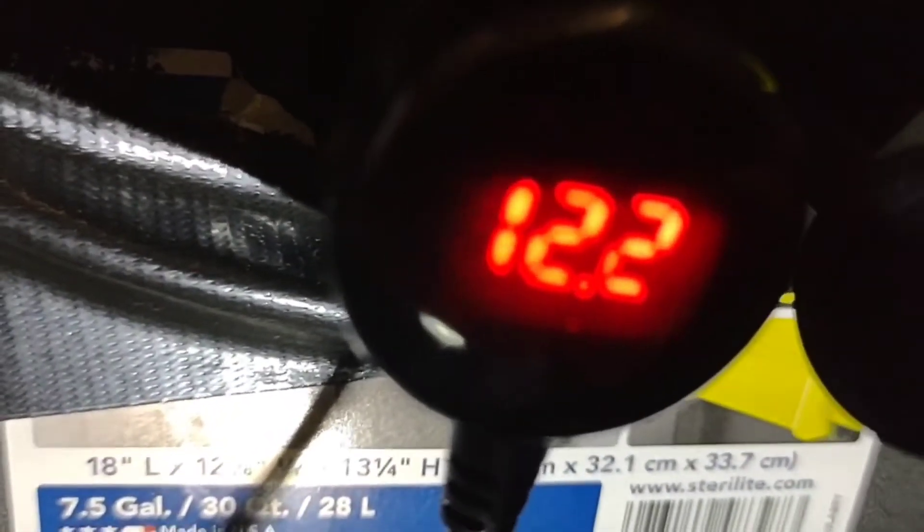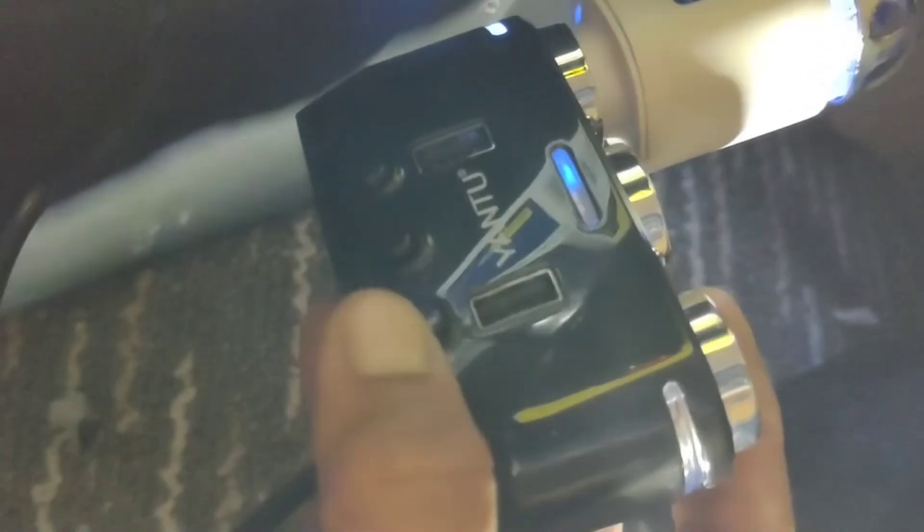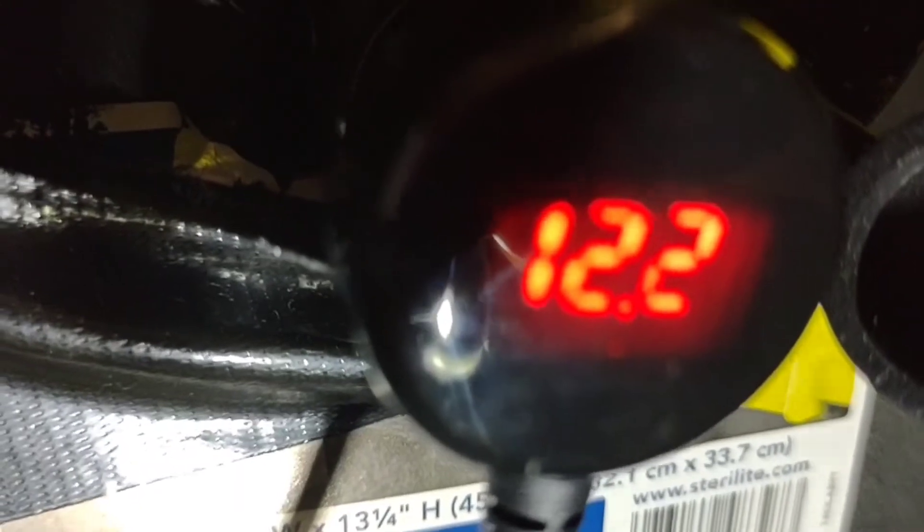I have it for two reasons — extra USBs, extra cigarette lighter ports. I have sockets for my fan or anything, two USB ports here, two others here. If I need the socket I turn that on — the blue light comes on. I'm only using one. As you can see, it was blinking when I came into my van. I always look at that — I don't have to go to my charge controller. It was blinking for the past week. I played around with it but I knew something was wrong. We took care of it today guys. Look — it's going up to almost 12.3 volts. The batteries are charged, it's just the system was not working.